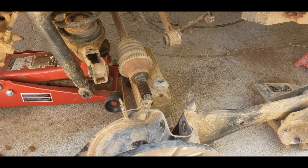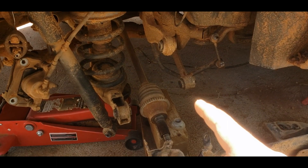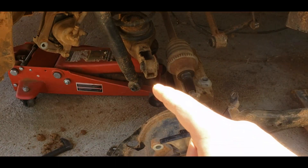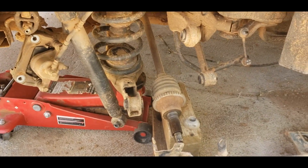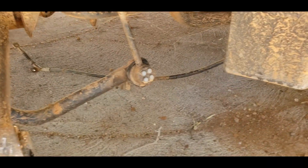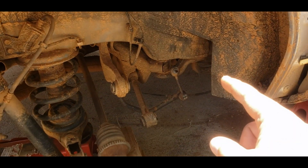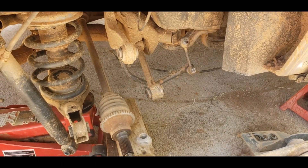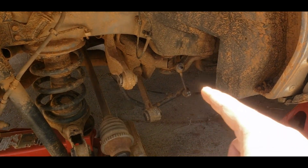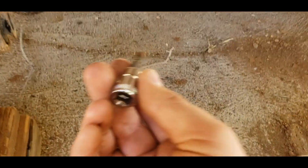Other sizes you'll need: 19 millimeter for the bolts that hold all the arms and linkages on, 17 millimeter for the shock absorber, and I think 17 is also what fits the caliper bolts. You'll want a 13 millimeter for the parking brake cable — there's one bolt that goes back up underneath and it's right next to where this part is bolted on. You'll need a 14 millimeter for the nut on what I believe is the trailing arm, and as you can see there's a hex head on that — let me find the socket right here.